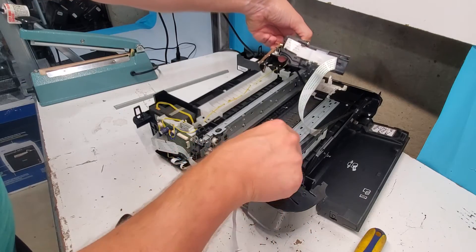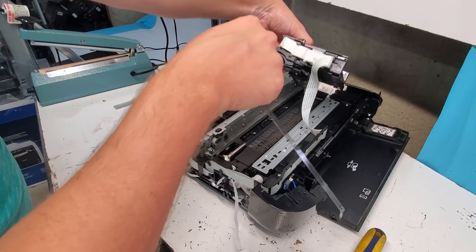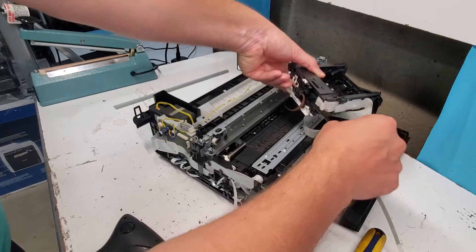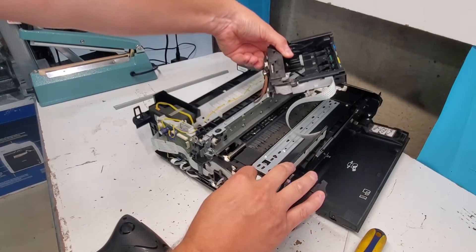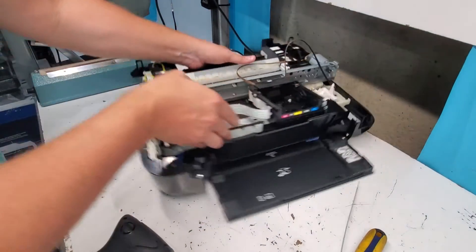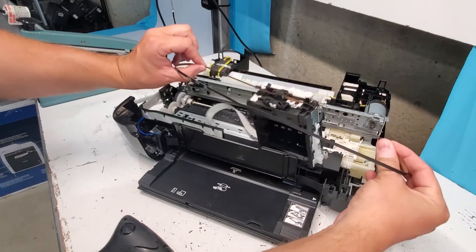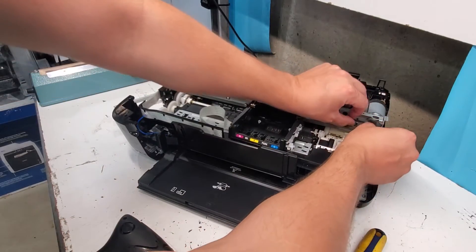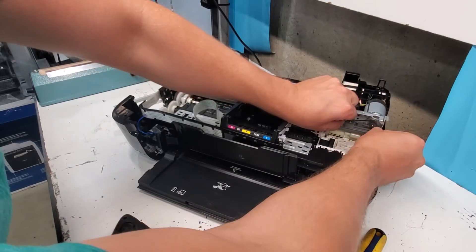When you're feeding the strip back in, it needs to go into the right place — right in between here, in between that area, so it's read by the sensor. This unscrews and you can remove this piece that holds the cord. Now to put it back in: first attach the belt. Make sure it is not twisted. You're going to connect it on this side, over that wheel — that's the tension wheel — and push it to attach over the motor wheel. Then slide the carrier in here, making sure it slides on this rail right here and that the belt looks proper.